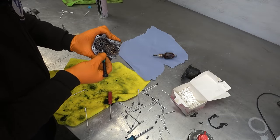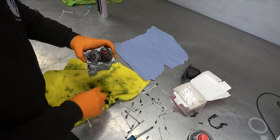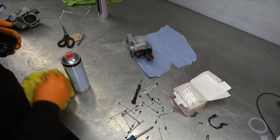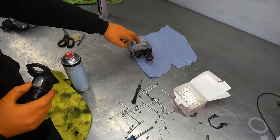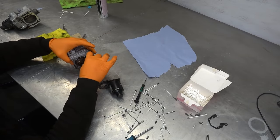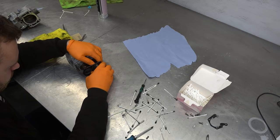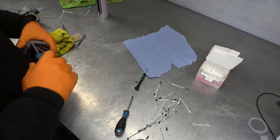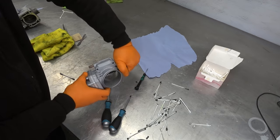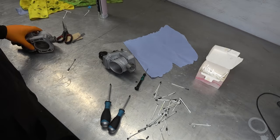Now retract the brushes, put the commutator in, push back the brushes. You can go a lot further cleaning this stuff — you can remove the plate and get to the gears in the back, but in my experience I've never had to do that. Carefully put it back together — the magnet is going to try and pull the commutator out so you have to do this gently and quickly. Sometimes they're so dirty inside that the flap won't even open or gets stuck along the way. Pretty simple stuff and it'll make a world of difference.